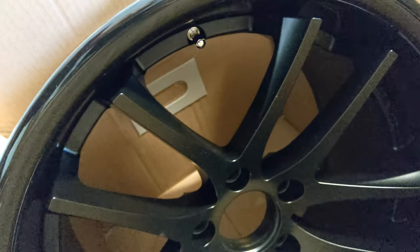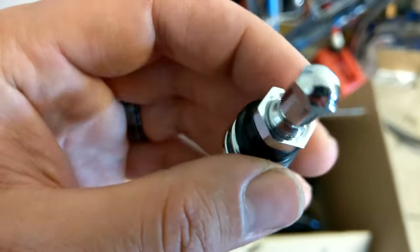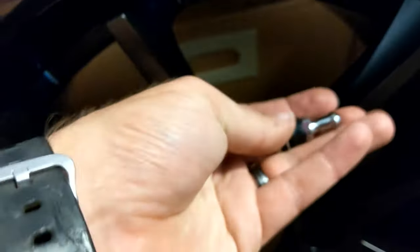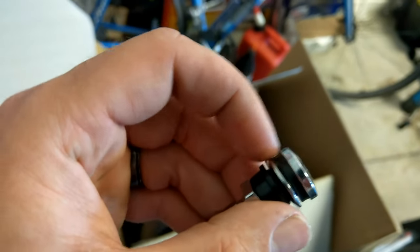So that's a quick overview of how to put metal bolt-on valve stems onto new wheels. One thing to mention: on a lot of stock wheels, the size of this washer indent is about 3/4 inch. But on some wheels, like these Robo wheels, it's actually 5/8 inch inside. So if you get one of those, the washer will not fit inside that indent and you'll be stuck. Make sure you order the right size washer for your application.